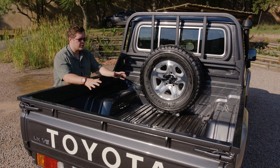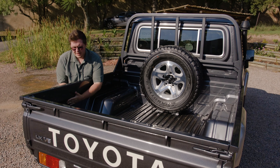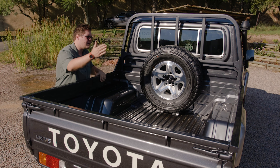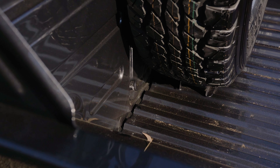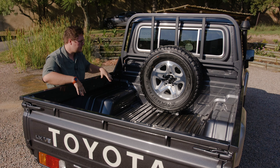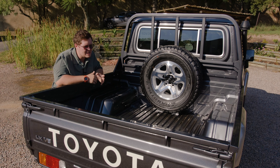So when we start at the back of a Cruiser, there are a couple of things you've got to look at. First of all, if you've maybe bought it second-hand or new — has it come with a rubberized tub? With the Cruiser, this is straight body panel here, so they would need to place in a second skin and then rubberize over it. You can't start the journey of having a dust and waterproof canopy until it's been rubberized. That's going to seal up a lot of the gaps in the bodywork where there are open spaces for dust to seep through into the tub.